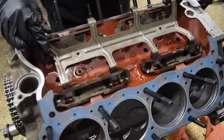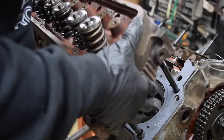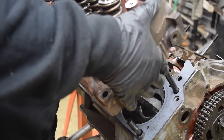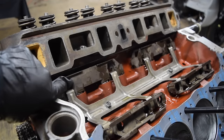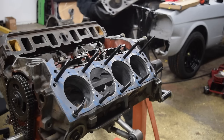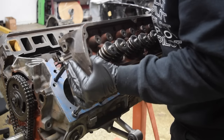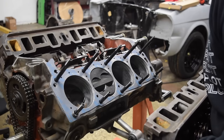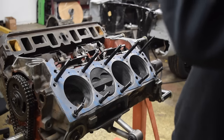With our lifters now installed, we can slip on the retainer — or spider, whatever it's called — and then back to the cylinder head. That's heavy. I'm glad we installed these retainers before putting the head on — I don't know if I could have slid them on with the head installed. I've already gone ahead and cleaned up the other head. One of the things about head studs is it makes it a little bit harder to throw on your head.